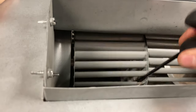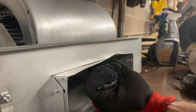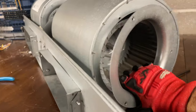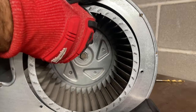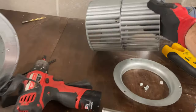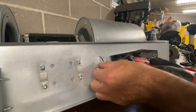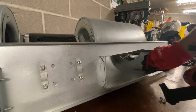Look for the little slot in the squirrel cage to indicate where you're going to put your allen wrench. I've already cut myself doing this — always wear gloves when working with any kind of metal. I'm going to remove this cover and then hopefully the squirrel cage just slides out. Set the squirrel cage down in the same direction you took it out so there's no confusion when putting it back. I'm then going to remove the lower housing. Not sure if this is the best way — if anyone has more experience, please leave a comment below.